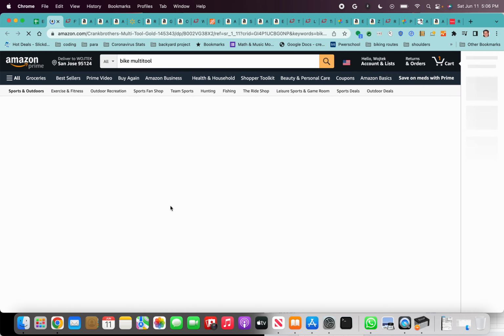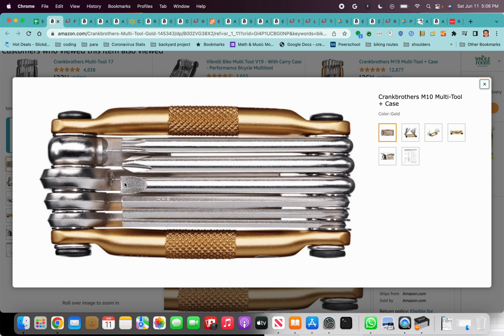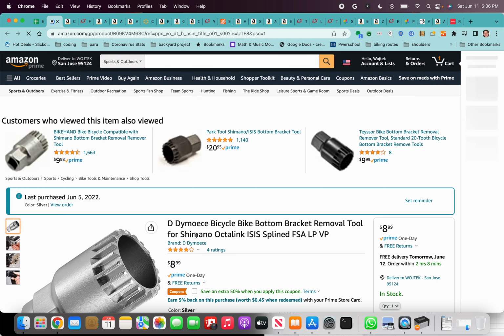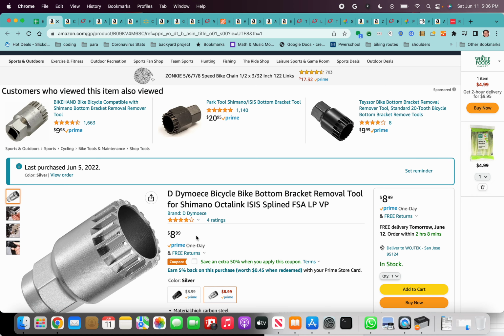You definitely need a multi-tool. You're not going to put this bike together without some kind of set of Allen keys. This guy will have all the Allen keys that you will need. Plus it has this Torx bit, which you need for removing the disc brake rotor. And the Phillips head, I think you need for removing one of the parking brake shifters. If you end up going with, there are other types of pedal assist sensors, and there are actual torque sensors, which will also measure how much torque you're putting into the crank, which I have one.